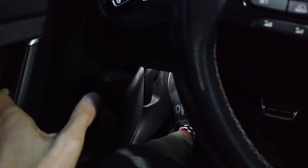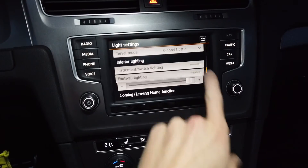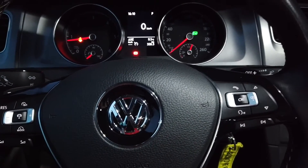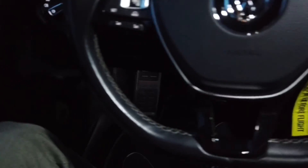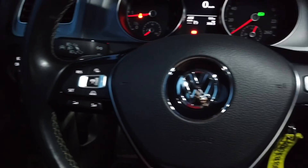When we go to car setup, lights, scroll down to footwell light, you can set it to max which is 100%. As you can see we have lights over here, and when I open the door it gets even brighter to match the courtesy lights in the roof. When I close it, it dims back to the setting set here, and I have full control from the infotainment. In part two, which will come, I will show you how to guide the wiring harness to the passenger side - right now as you can see it's dark over there. I had time only to install the driver's side and tuck the cables under the dashboard just to not damage them by mistake.